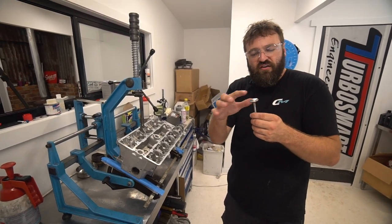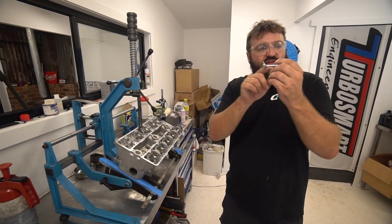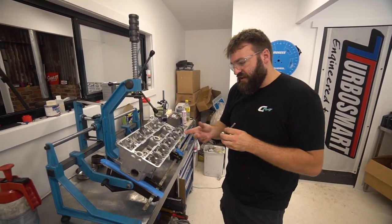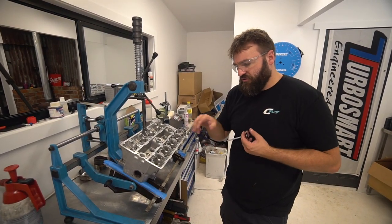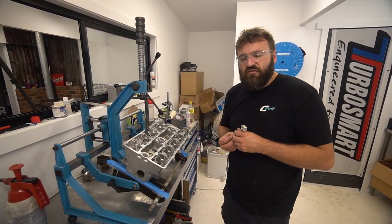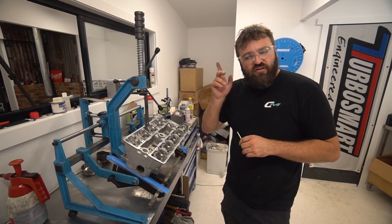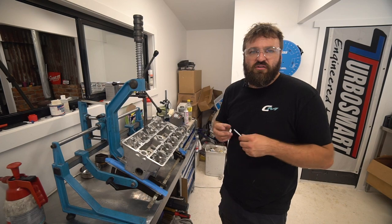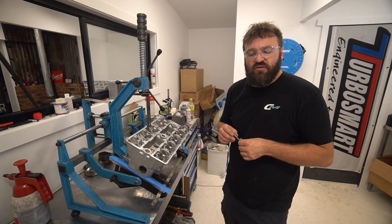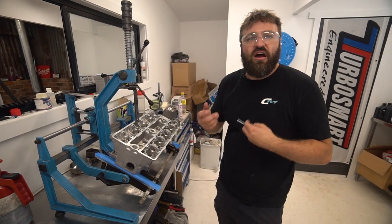Okay, yep. So when the valve starts to cup and buckle, then the valve goes in, so that reduces your clearance. When that starts to happen, there's a few things you can do. You can give it extra clearance, and if it moves again, stop the motor, she's going to hurt. We've done that with yours. I started to hear a misfire, I was like, something's wrong here. So we checked it, no clearance, and corrected it. If it moves again, the cylinder head's coming off. We've got to start looking for an issue.